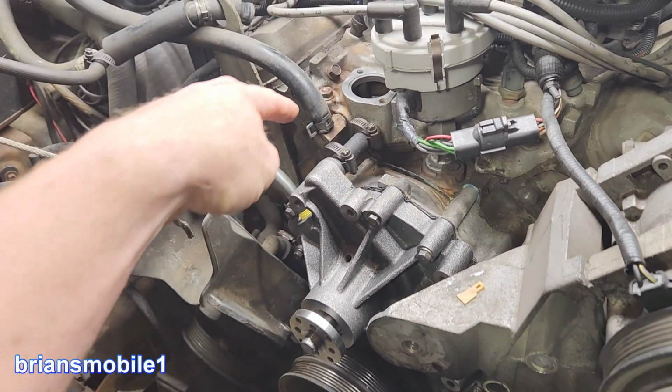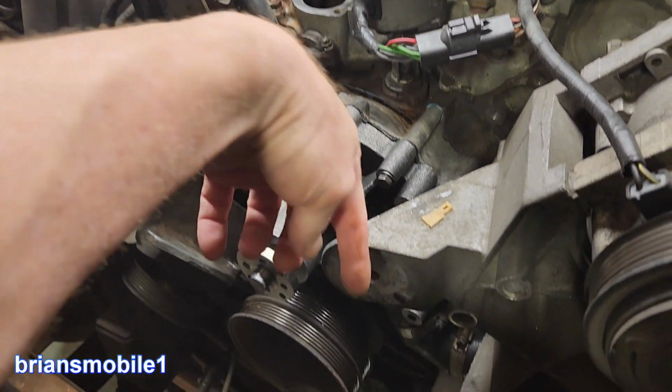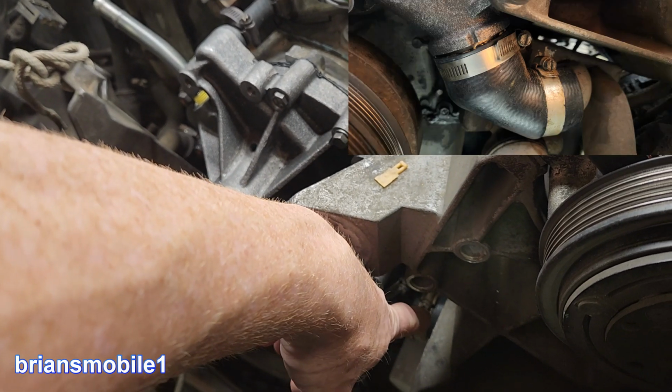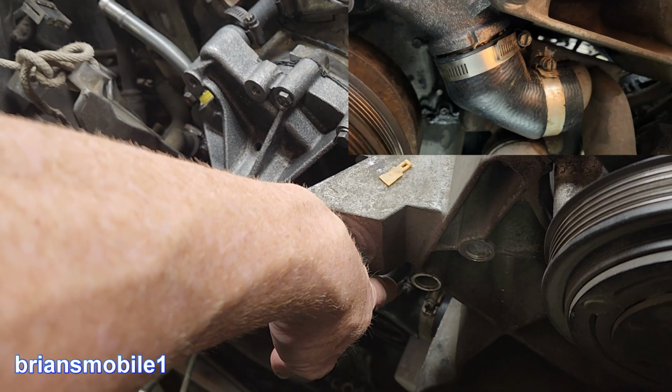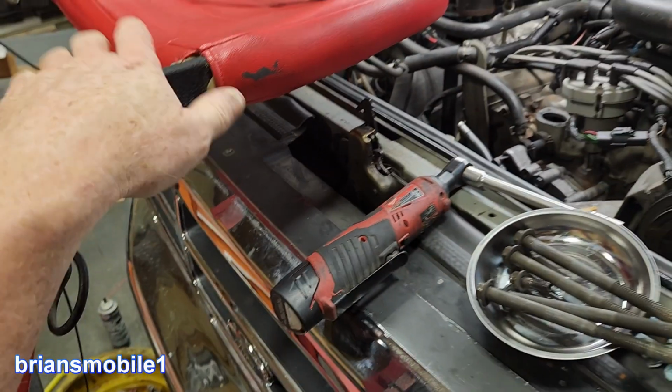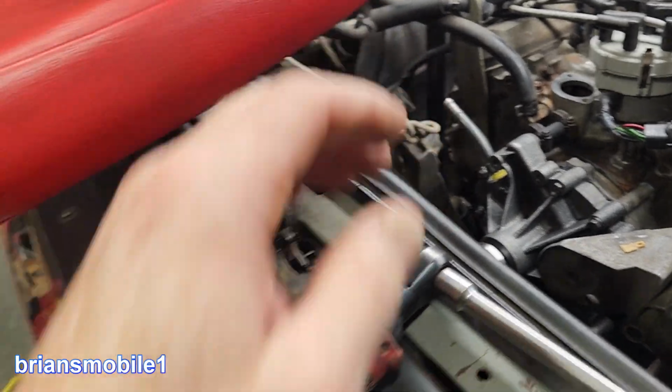When you go to hang the pump, you've got 2 clamps on this hose. You've got that one. This one's already tightened up how it should be, and then that one's just tight enough to not fall off. You stab this on first. You'll notice that I use a topside creeper. It makes it a lot easier.